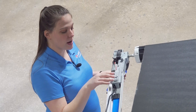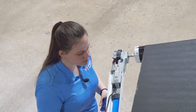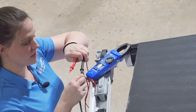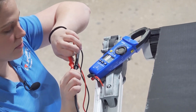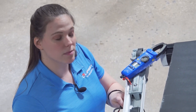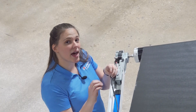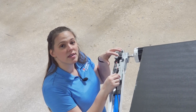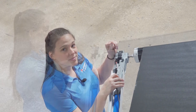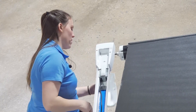Be careful not to lose your wires inside the assembly, or you'll have to disconnect the whole assembly from the arm. When you're ready, disconnect and place your probes into the bottom of the harness. Either you or a helper activates the switch at the bottom of the mount arm. After checking this harness, if you find that you do have good voltage coming through to the motor, that means your motor is no longer functioning properly and will need to be replaced. Replace the back cover, secure it, and then replace the front cover.